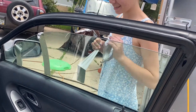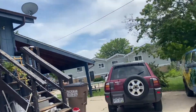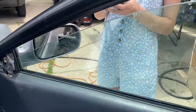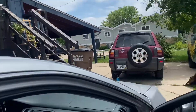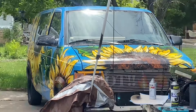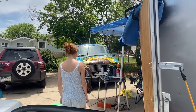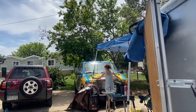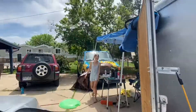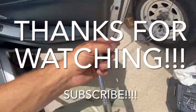We had to put the thing on backwards at first — passenger princess gets her window again! Still got enough juice to start so we're fine. Hope you guys enjoyed the video. There'll probably be a video on this soon 'cause she's running better — the idle was bad but I found this wire that was unplugged, plugged it back in, plugged the PCV valve in where it needed to go, and it made it run better. I'm thinking of replacing the other PCV valve too, and an oil change. But yeah, let's put this away — it's hot.